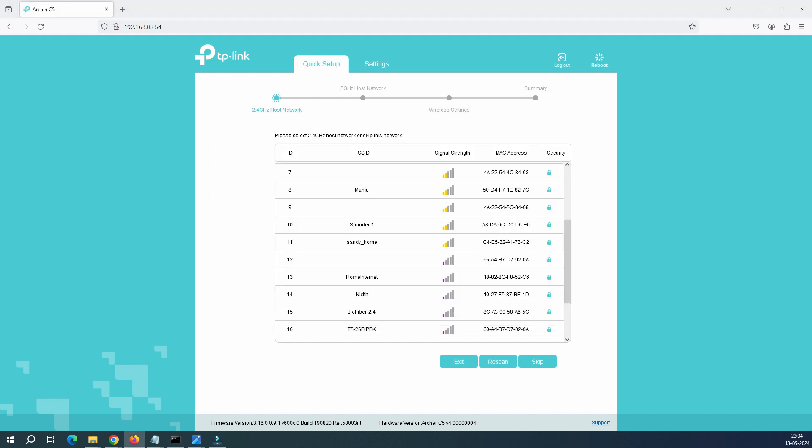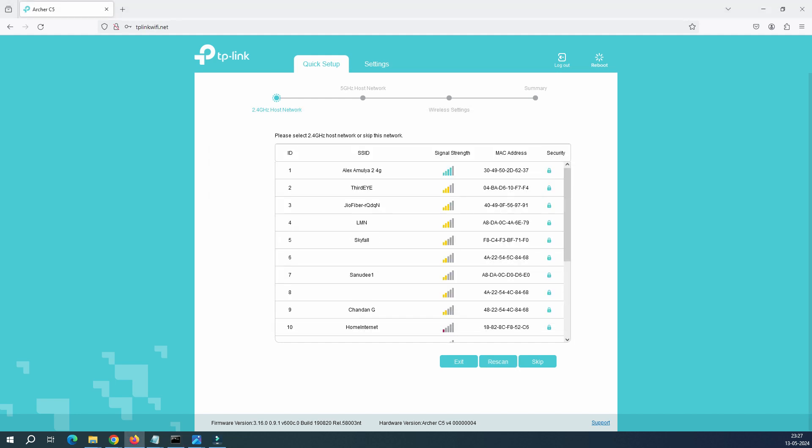I'm not able to reach Google DNS or google.com, confirming no internet. Now it's time to connect our Wi-Fi extender to the main router. If you have a main router with internet and it's a dual-band router — most routers nowadays are dual band — it provides both 2.4 GHz and 5 GHz signals.